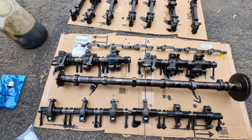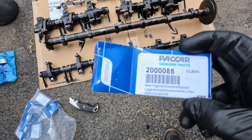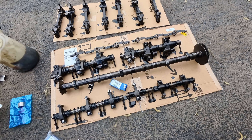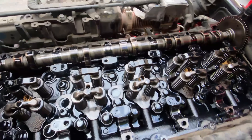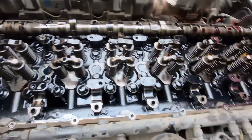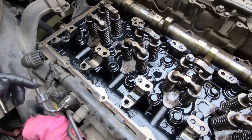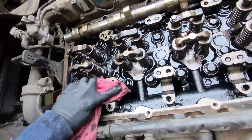So this is our top end we've got to work on now. We've got uppers and lowers to fit here — one says upper, one says lower, and apparently you knock and welly them in, so those must be the fitting instructions for these bearings. We'll get these bearings put in their caps and in the cylinder head. We'll prep the cylinder head now, clean up all around this mating surface here with brake cleaner and a rag. We'll change our bearings, get all them wiped out before we oil the new bearings. Some of the bearings have come out with the camshaft — we've got five still in, so we'll just knock these out and put our new ones in.